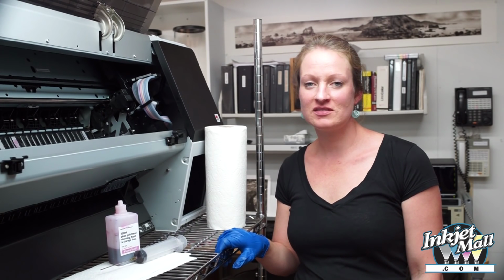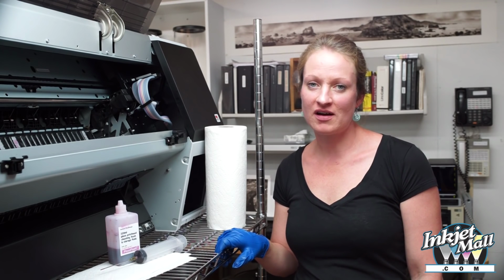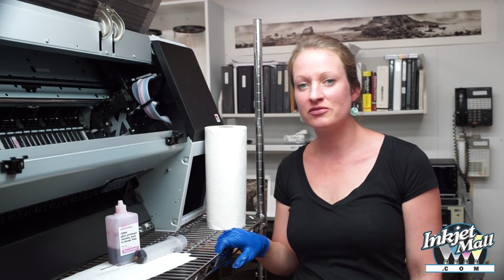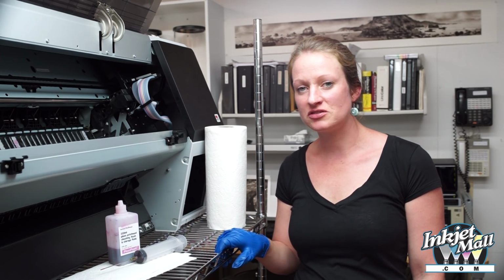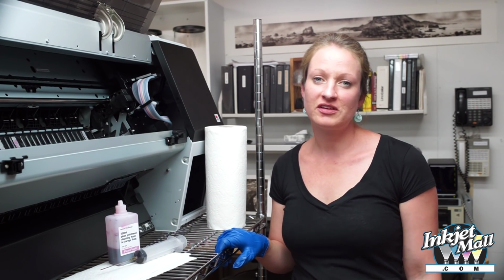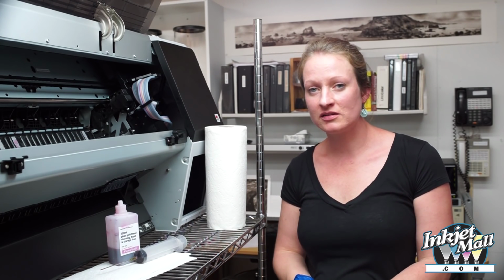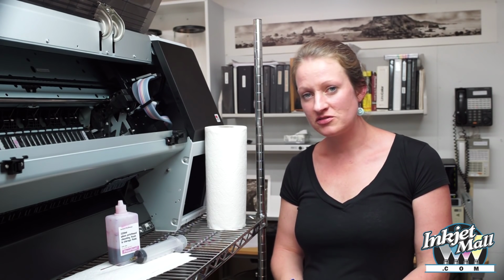If you still have stubborn clogged nozzles or misfiring nozzles, another thing that you could try is installing a set of piezo flush cartridges and running an initial fill cycle to purge the ink system and allow the piezo flush to clean. A lot of times we have actually brought back clogged print head channels that way. Make sure to reference our video on how to run an initial fill and flush your printer.